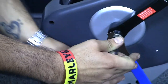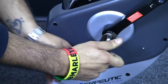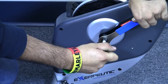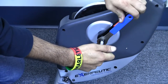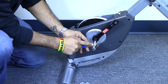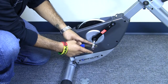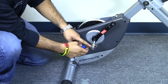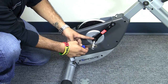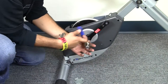Sometimes it can be difficult for the crank to come off, which is why the tool needs to be turned in quite a few times. Once you feel it's on there and tight, you will then use the silver portion — by screwing the silver portion into the crank, it inserts leverage and pushes the crank arm out.